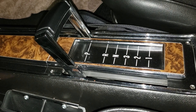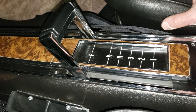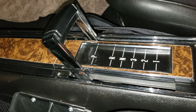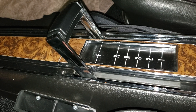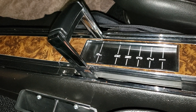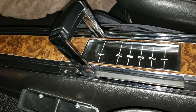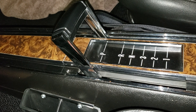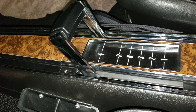I'm working on the TS-4 shifter detent plate for the horseshoe shifter in my car. I got a phone call from a man today that was wanting to know if it was possible to downshift from overdrive to third gear and not slip into second accidentally if you want to do it fast, and it so happens that the design of this TS-4 will let you do that.